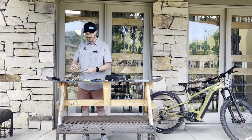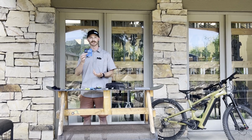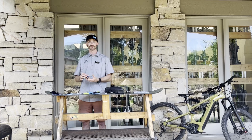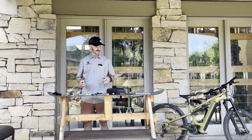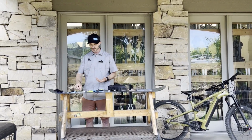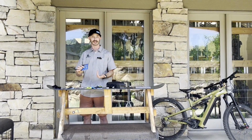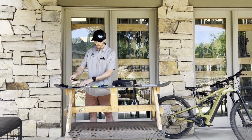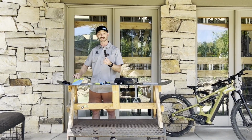So this next piece, this is something that everyone should have in their riding bag. You don't necessarily need two, but at least one. What this is going to be, this is a quick insert or quick release link that will replace the stationary links on your chain. So that piece that breaks, it's almost always the outer link on your chain. So we need to replace an outer link. So we'll have that. We've got a couple other things here. KMC makes this chain aid tire lever.